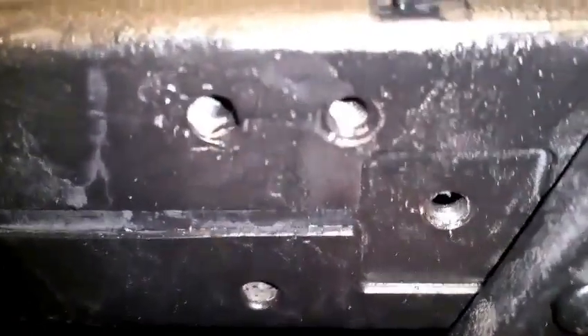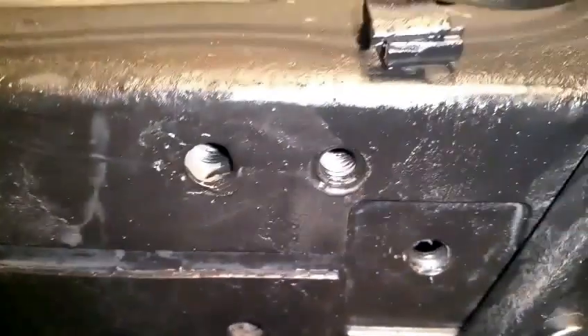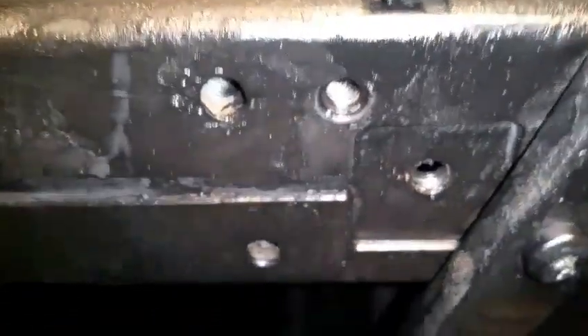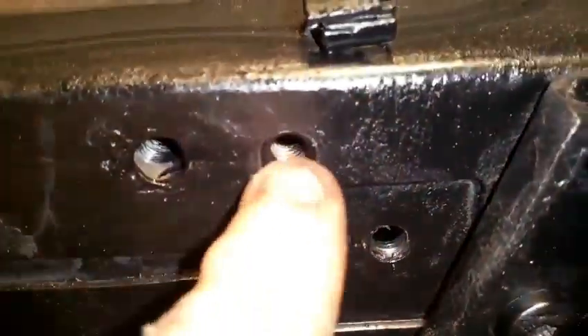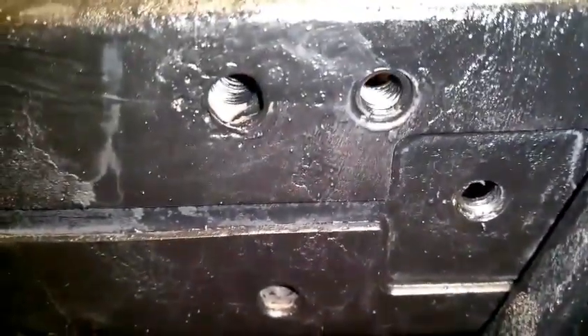What I did on the first one I tried — this one — the nut turned into a molten blob basically. So what I had to do in the end was drill upwards through here, tap it and helicoil it, so it's nice and strong now — it's going nowhere.